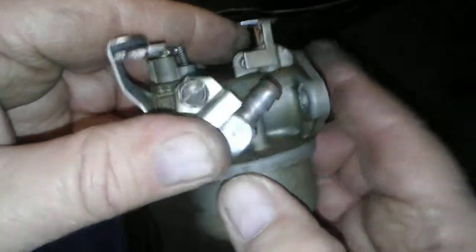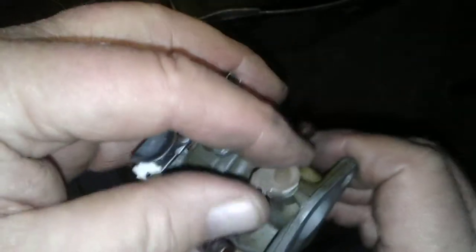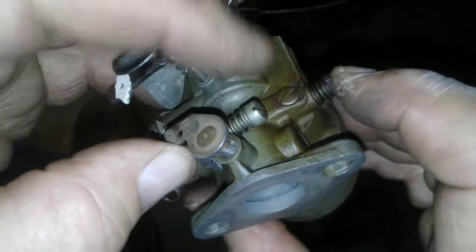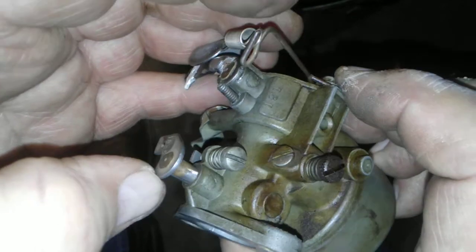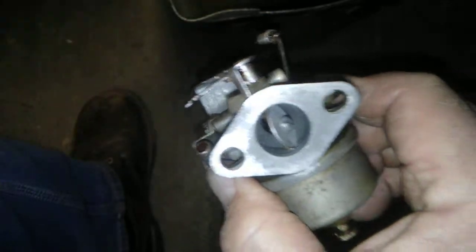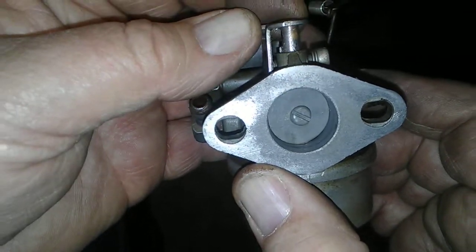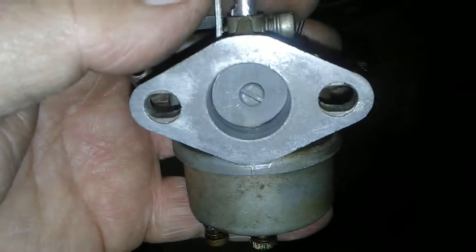I put a little cheater on there because that just drives in — I didn't like the looks of it. But anyway, that's got a good tight throttle shaft now, almost no movement. My fine adjustment on the low speed will be a whole lot more — it'll work better, it'll idle smoother, it'll take gas better when it's cold. If this looked interesting and you want to see any more crazy crap, check out John Wade YouTube — W-A-D-E. Thanks for watching, bye-bye.